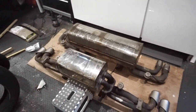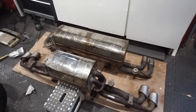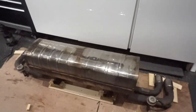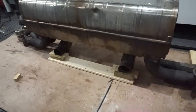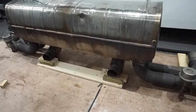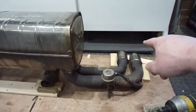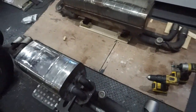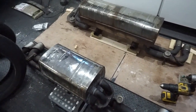I'm going to make the jig and then we'll get on with taking this, cutting it, chopping it, shortening it, and doing the welding. Got a jig made up now — I've packed up this piece here and got it around so when I offer up the new exhaust, the inlets from the cats will know exactly where they should be. We'll then adjust and modify the new tips so we get them in the correct location, flat to the board. The new system will be offered up, cut and chopped accordingly, and then TIG welded back together.